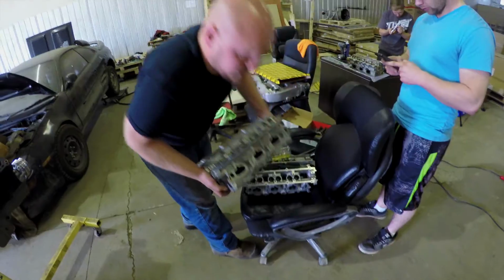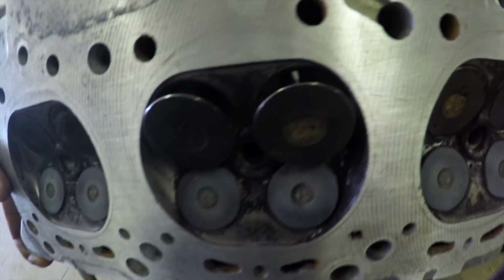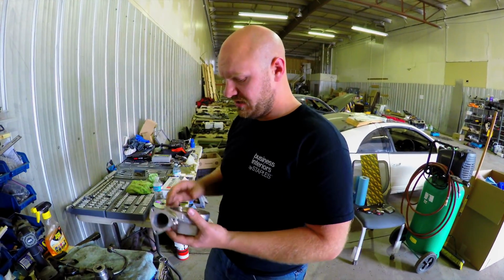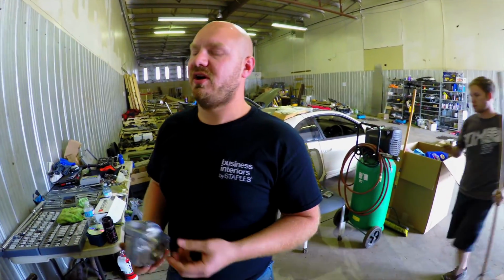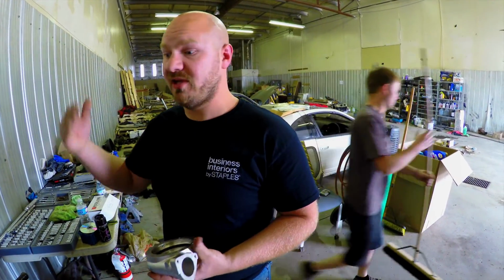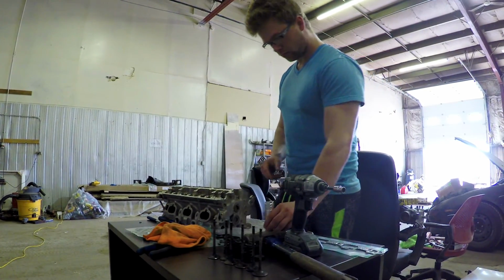Anyway, every second valve in was slightly deeper into the head than the other one. It was consistent among both sides of the heads, and it was always the one farthest from the edge of the head. So I looked up Nissan weak valves, and sure enough, any motor that's got a 30 stamp on the valve for the intake side is made out of weaker material than updated versions. So long and the short, the valves were bad.